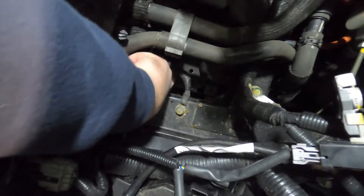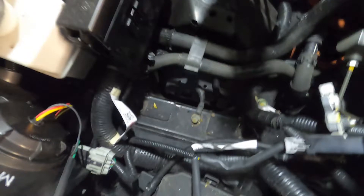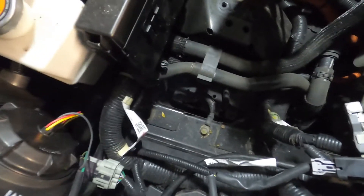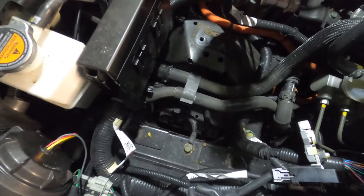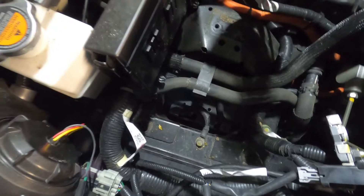The first little update: down below these hoses is where the PTC heater is. This wire you see coming up here actually goes down to the PTC heater, which I can touch with my finger — so it's accessed from down below the car. One thing not included in that step was to take the battery tray out — we just did, and I'm glad we did. It gives us a clue as to where it's located. All this work will be accessed from the neighborhood of the front driver's side tire.